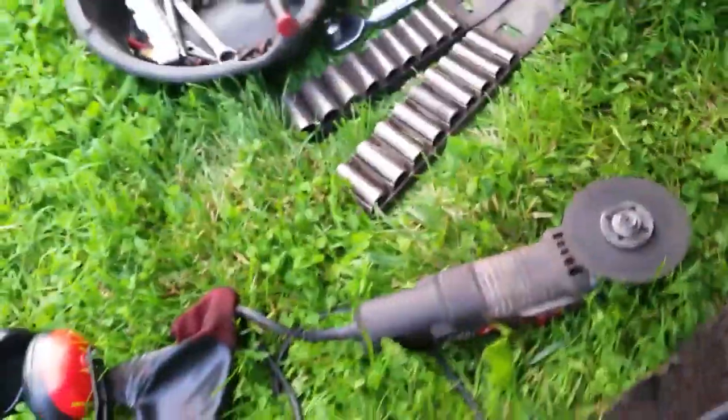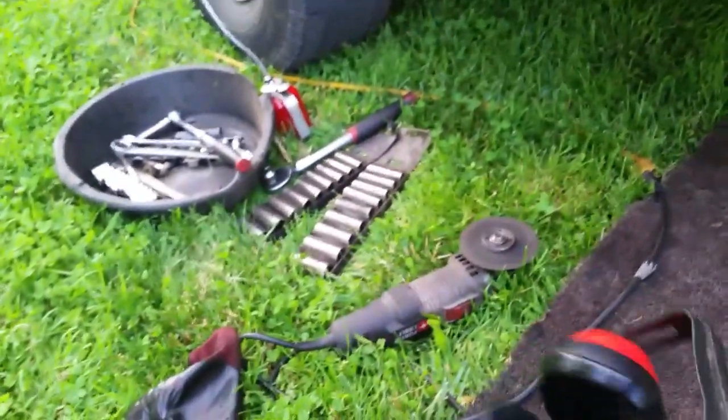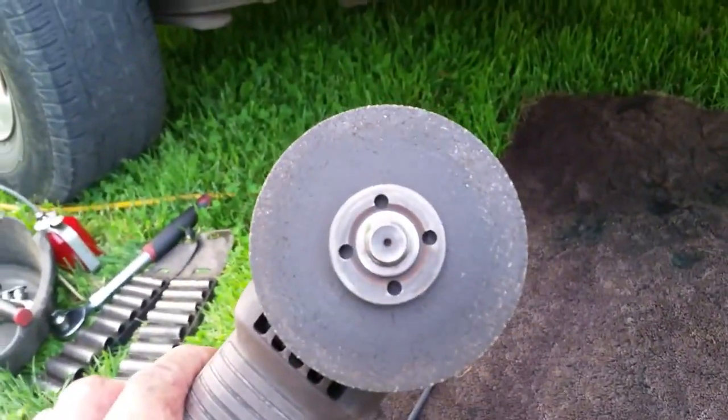Underneath, I've taken a grinder. Folks, this is no joke — if you're going to use a grinder, make sure you protect your hearing. I use ear protection because it's noisy. I have glasses and gloves and this little thin cutting wheel — it's been worn down a little bit. I've got the two bolts cut off. I cut them off on this side, and the one on the bottom here is snipped off too. You can see there's a gap there — this thing is ready to come off.